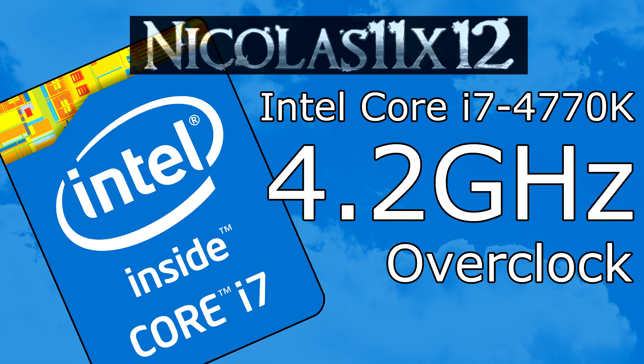As you've probably already expected, the temperatures will get really high. I tested these with Aida64, and with my Corsair H100i water cooler I reached temperatures all the way up to the 90s — 93 degrees Celsius to be exact. That's pretty high. Just like the temperatures, the power consumption also increased.